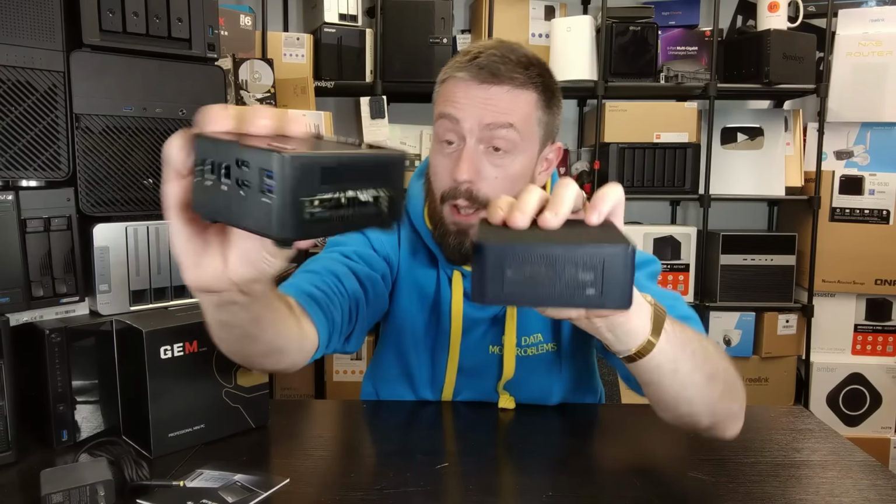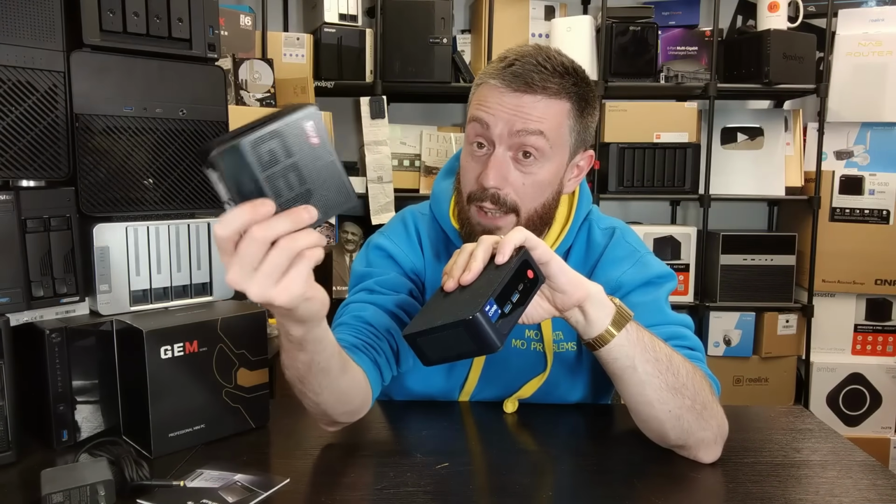This is far removed from something like this, your little mini PCs. A lot more work has gone into the cooling systems inside, and you can feel it in the weight, you can feel it in the quality of the device. I'm not going to say it's a perfect NAS. I think a lot of perfect NASs out there would have 10 GbE with this kind of architecture, or maybe they could forsake a few things, maybe bring those slots down to x2, and maybe by that, we could have added another M2 NVMe inside. But those small gripes aside, to find a great balance between high performance SSDs and the number of storage bays, this is a decent little balance in the middle.